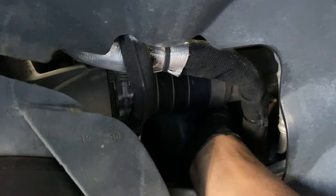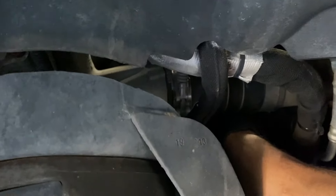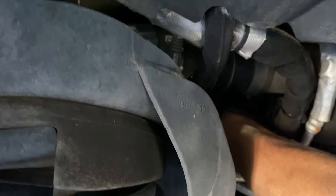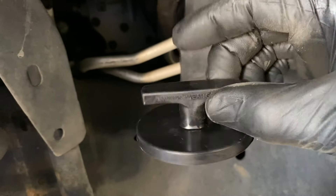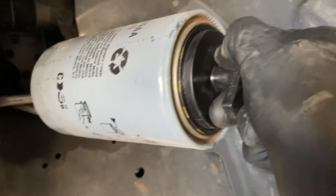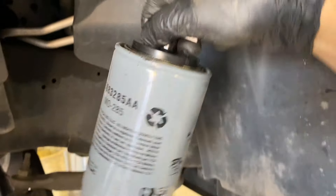Now when you drain the engine oil, usually the oil filter won't leak any oil, but when you tilt the oil filter it will leak oil. I have a tool — very cheap, made out of plastic — you screw this in. The link is in the description. This is a mess saver: there will be no oil spots on the floor when using it. I just screw it in, it seals on the o-ring, and now I can pull it out mess free.